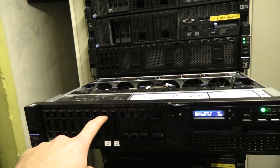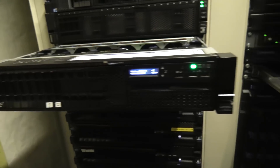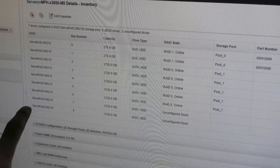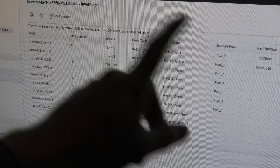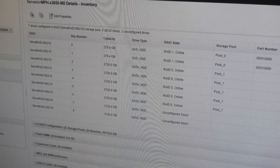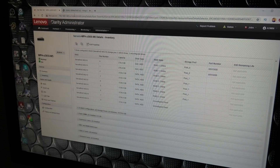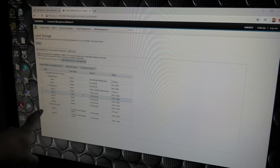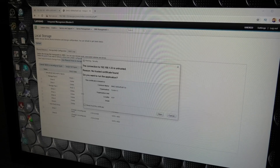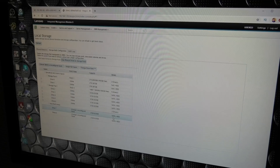There's light in this one — it's kind of doing the same thing as before. What would you know — we still have a couple of drives here that are available! In the XClarity Administrator, which gets its data from the IMM2 on the server itself, just to make sure it hadn't cached old data, I went in there as well and it sees the drives. They show as foreign because I never configured them — but it sees the drives. I think we actually fixed it!